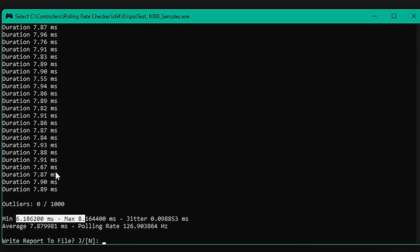I'm going to give stock input lag a 2.5 out of 5 as it is subpar — worse than virtually all other PlayStation controllers I've tested. Let's overclock. In the Lord of Mice overclocking program, expanding child names, our controller is right there as an HID compliant game controller. Selecting 1000 Hz — filter on device, install service — unplugging the stock controller, replugging a modified beast reflecting an overclock at 1000 Hz for an estimated 1 millisecond of input lag or delay. The cookie crumbled identically — this controller is polling rate locked at least with the wired method.